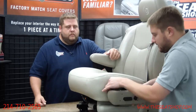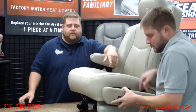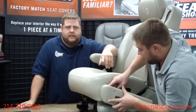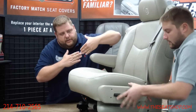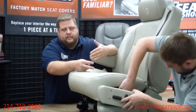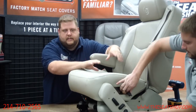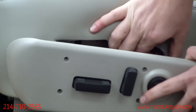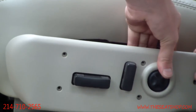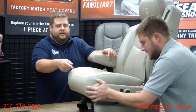Come back and connect these two power connections here — you get the one in the front and the one in the back. Once you've got them connected, you want to try to feed the front one in first so the back end will flare out and you'll push the front end under, because there's a little lip on the front end that the plug needs to get behind. If you try to push it straight down into the hole on the side, the front plug will catch on a little part of the frame. So tilt the back end out, rock it in forward, then pull the panel on the side — it's going to go a lot easier and won't pinch all your wires on the front.